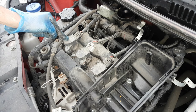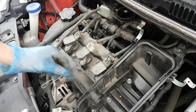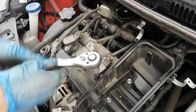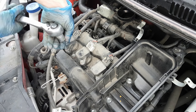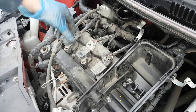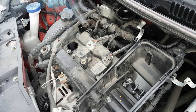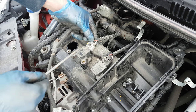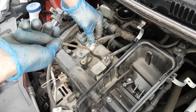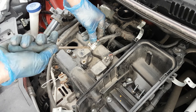In order to take them out, I am going to use a 10mm socket. The air filter box on this car is a great holder for the bolts. Now you can just pull out the coil packs, and if you want to remove the electric connector, just press on this clamp over here and with a flat head screwdriver, release the connector.